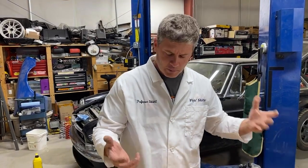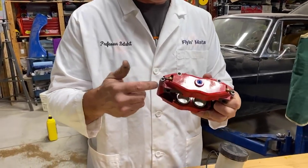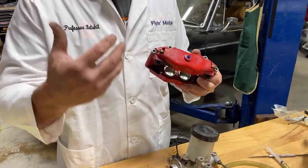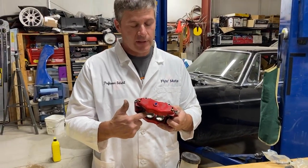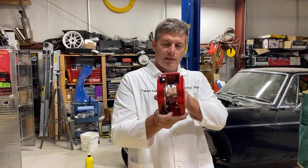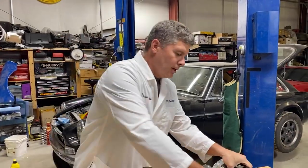This four-piston caliper is a front replacement. Stock Miata front pistons are two inches in diameter; this replacement uses 1⅜-inch pistons. Do the math and you get about three square inches of area — basically where a two-inch piston ends up. So two 1⅜-inch pistons are equivalent to one two-inch piston. On an opposed piston caliper, only count one side since each piston moves half as far. On a sliding caliper with one piston, just count that one. That distinction can catch you out.